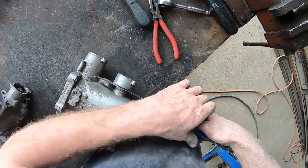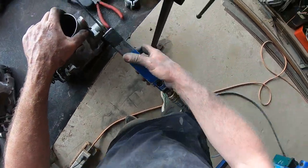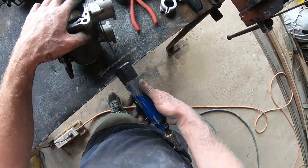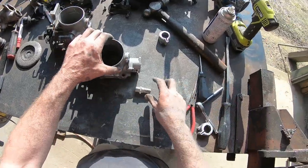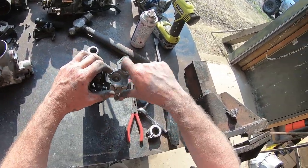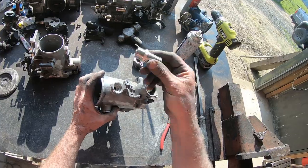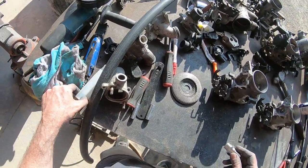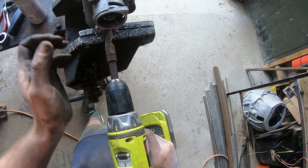It'll just fall off - reality takes a little bit longer and I've got a second one to do. With the hacksaw job done - water jacket's gone, trimmed off the bottom of that bracket, trimmed off the front of where the secondary TPS went. Now I'm going to drill a hole out so we can drill and tap that. I'm using a half BSP barb - in with the drill.